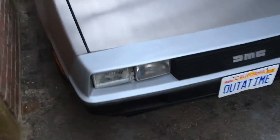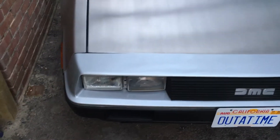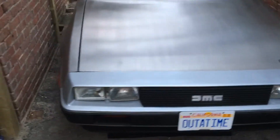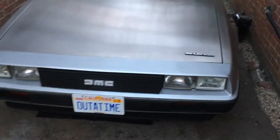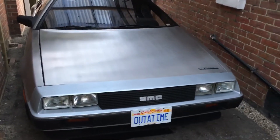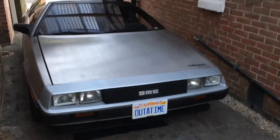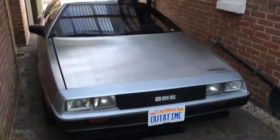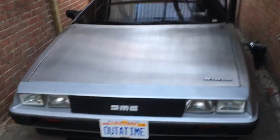My ones actually had some damage literally here and some more damage roughly there — two blatant patches and a few very light cracks in the plastic. What I did is I just rubbed it all down, got rid of those marks, then basically primed it and used some silver paint I found. That was the only shop open at the moment in lockdown. Got a number of cans of that as well as lacquer. Rubbed it down, masked it all up, sprayed it, let it dry, lacquered it, and that's it.